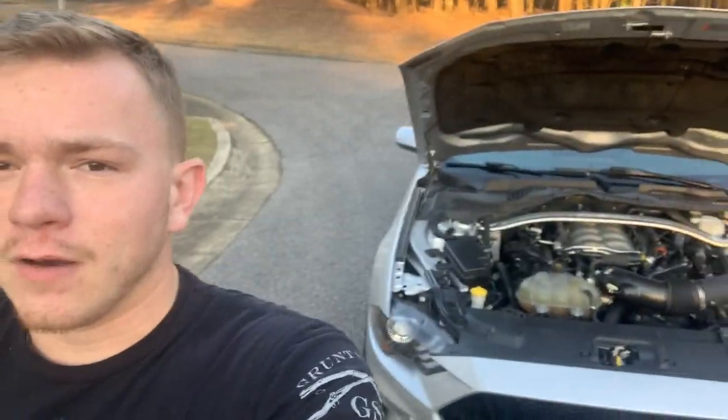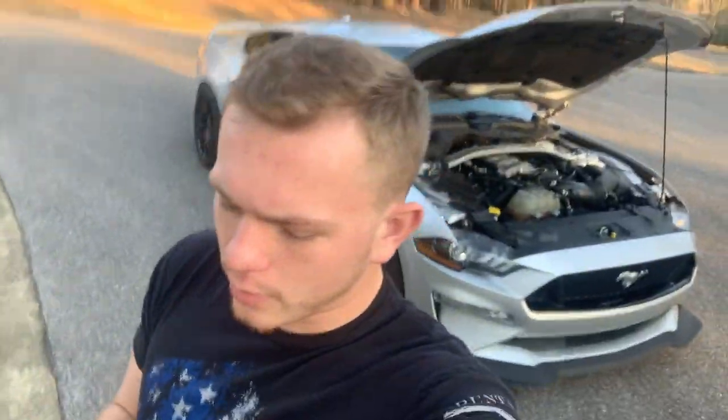Yeah, that's the car — it made 500 horsepower as you can see. A lot of people on the mustang forums are saying it was a happy dyno and it shouldn't really make that much. Keep in mind that was an uncorrected number. Corrected, it was probably around 475. But on that day here in Alabama it made 499 horsepower. We did a couple runs — first was 493, then 496, then 497, then we finally got the 499.7 on the last run once the motor warmed up a little bit.